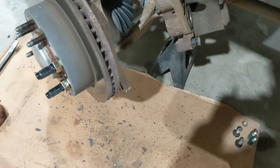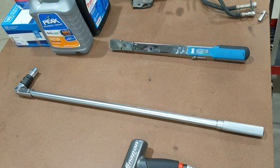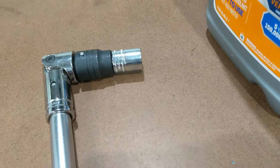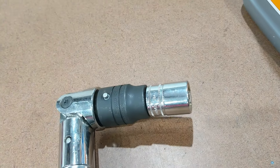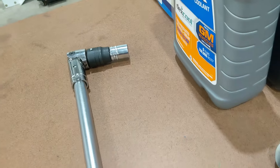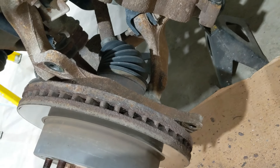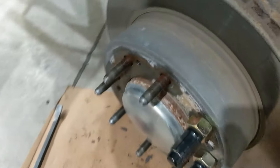On the top bolt there's a shock and other stuff in the way, so there isn't enough room to get a power tool on it — you've got to resort to hand force. I had to use a three-quarter inch breaker bar about three and a half feet long, reduced down to half inch with a Snap-on reducer and a six-point 21mm socket. It didn't move until I was putting maybe 400 foot-pounds on it. It's very tight, so prepare yourself — you're going to have a hard time with half-inch drive.